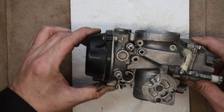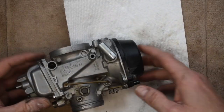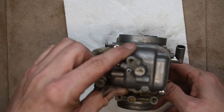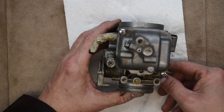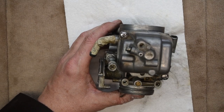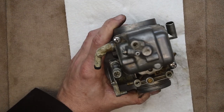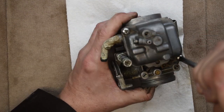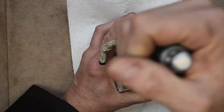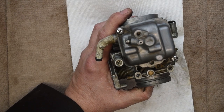The first thing is to make sure the fasteners you want to take out will actually come out. I'm going to start by setting it up on the vacuum cap and breaking the float bowl screws free — just break them free so I know that when I get to that point, they'll come out without too much problem.